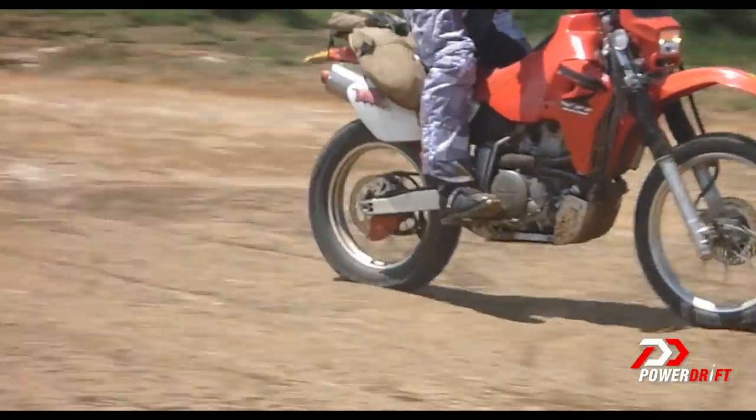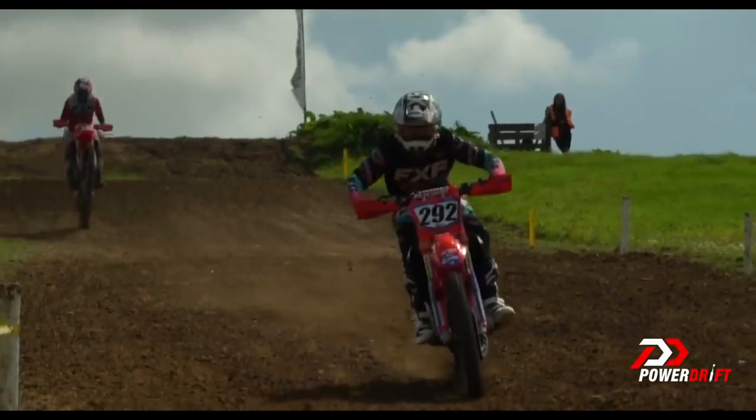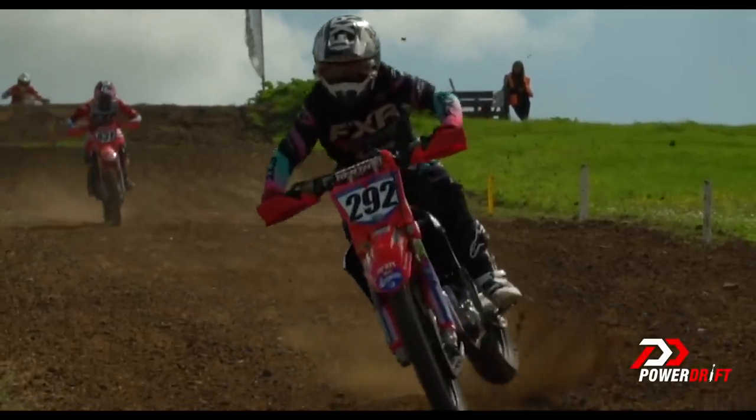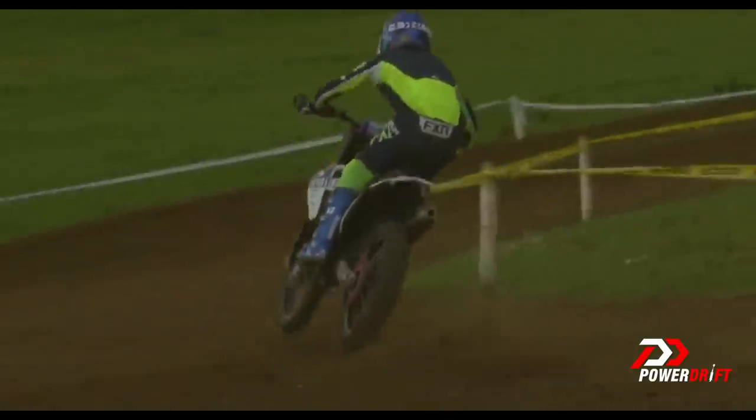There is good reason to have both choices available depending on what your motorcycle is and where you're going to ride it. For example, if you're riding in the dirt where bumps are larger and more unpredictable, if you have too little compression damping, your wheel can move through the stroke too quickly, making you extremely uncomfortable because the motorcycle will feel like it's pogoing and bouncing around. On the flip side, if you have too much compression damping, it will barely move when it hits a bump, which means the entire motorcycle gets jolted around.